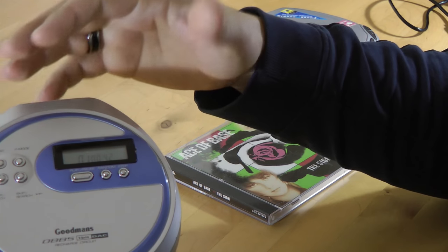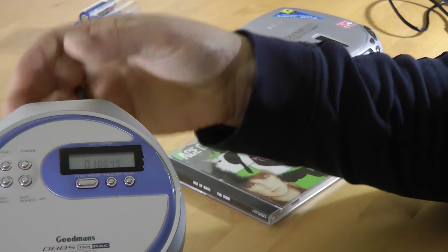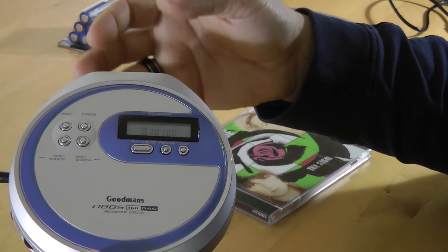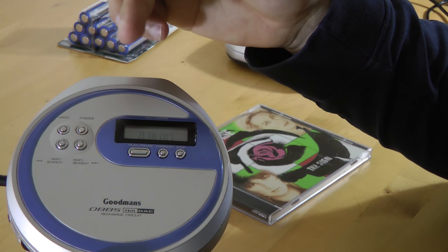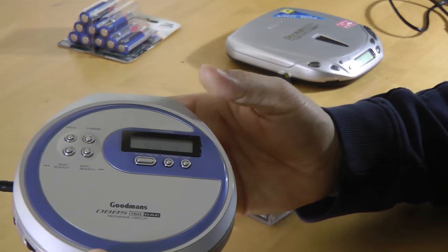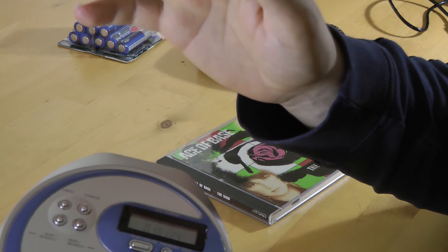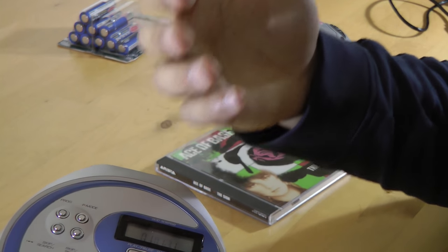This worked great for the most part. You can load CDs in, but the challenge with something like this is that it's almost like live music — as it's reading, it's playing the song with no buffering at all. There was no buffering capability because of the expense of memory chips and circuits. So as it was spinning, the laser was reading the valleys and mountains, converting that using a digital-to-analog converter, and bringing that signal up to your headphones. That meant something very simple — and this is why ESP became such a revolutionary approach.